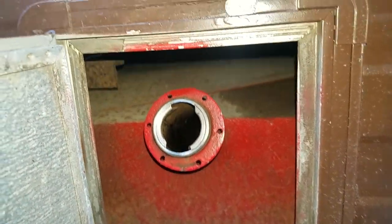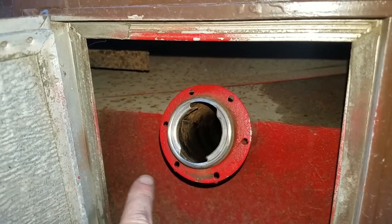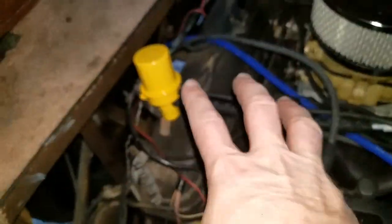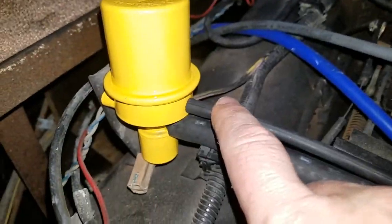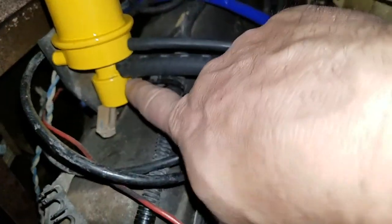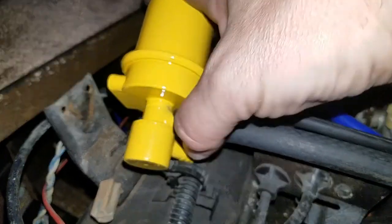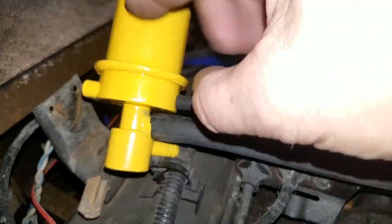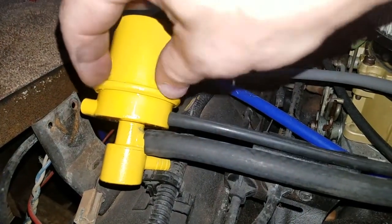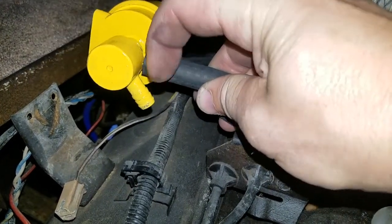You can see the vapors coming out — you can see a little bit of ripple down in that corner there based on the lamp. You can see here my bright yellow — this is a vacuum-actuated valve. There's a vacuum line here, and what it does is when that vacuum is activated, it pushes a plunger down and allows flow. There's a little valve in here and a rubber stopper. When the vacuum sucks, it creates a vacuum here and pulls this whole plate down inside the cylinder. Then the plunger drops down and allows anything to flow through this part of the valve.